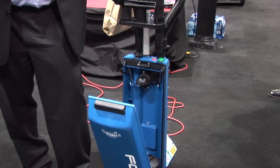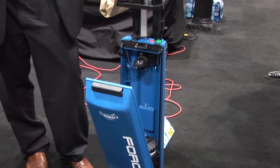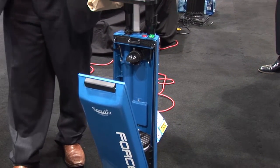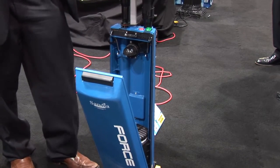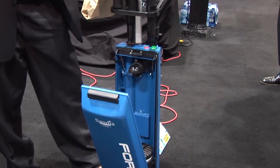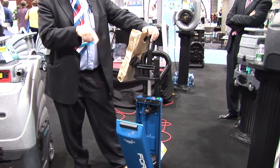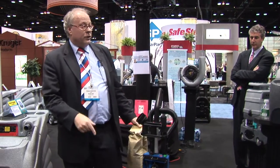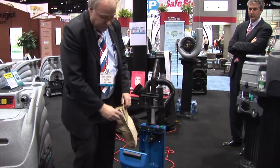One of the things you don't want with uprights is that they start to vacuum without bags. Because the motor is sitting right there, whatever comes in wants to go into the motor. These units are difficult to clean out again, so that's why we make a system where you cannot close the door without having a bag inside. That's what the finger does for you.